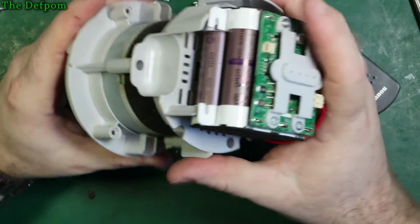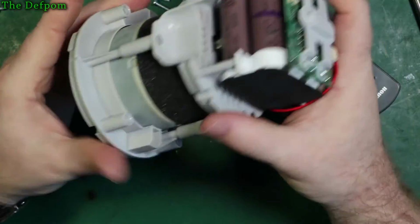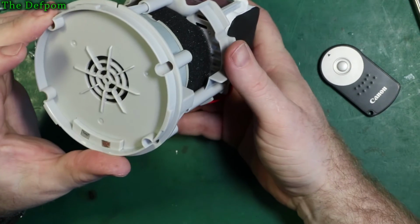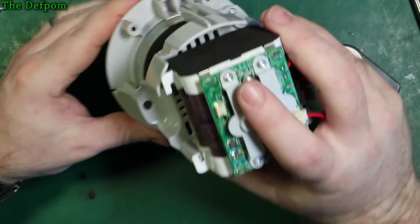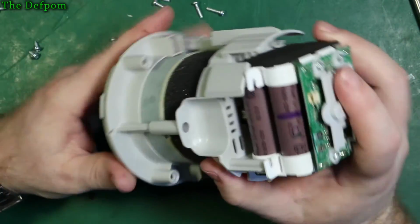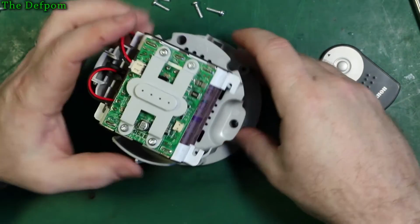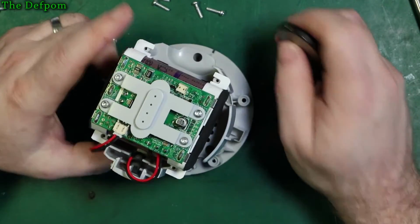Usually you can smell it, but I can't smell it in this case. It's got overpowered by other stuff, like the foam and the batteries. Anyway, it may not be flame retardant ABS. Usually ABS FR would be marked as ABS-FR, and it is not. So it may not be a flame retardant one, but usually electrical stuff has flame retardant ABS in it.